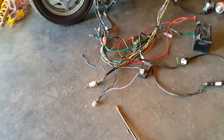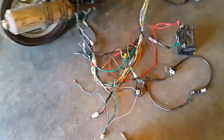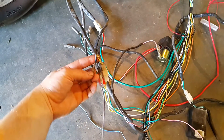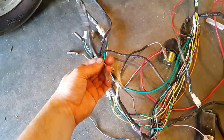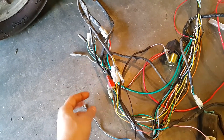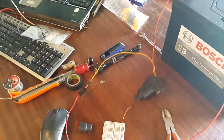This pink wire over here — actually it's not a pink wire, that's the speed limiter on this thing. The blue wire here gives out a 5-volt pulse, so instead of me pushing the button I just have that push my button instead, and then it should hopefully create a spark. I just got to figure out how to hook up a Subaru coil to a spark plug.